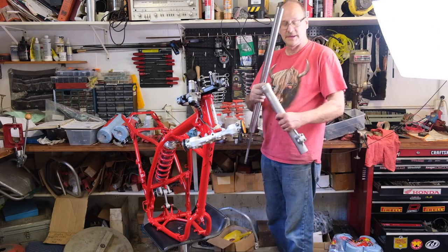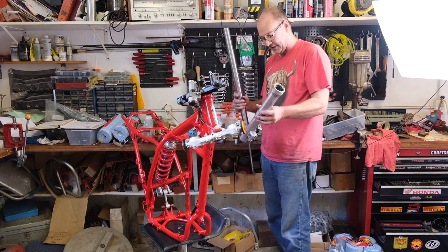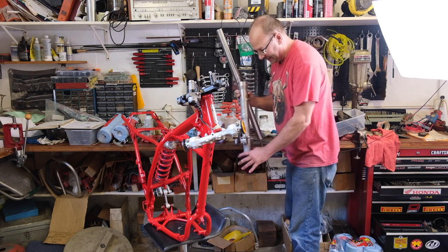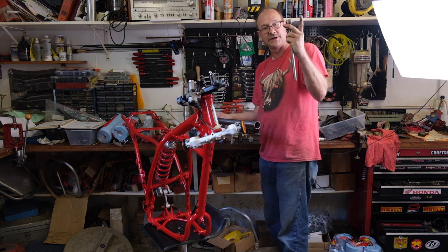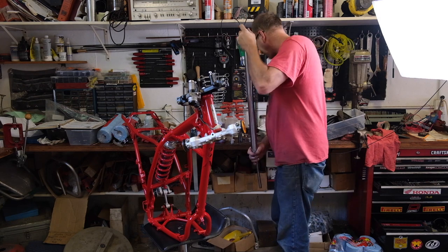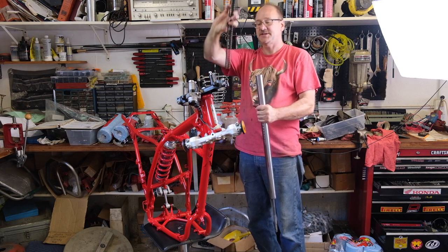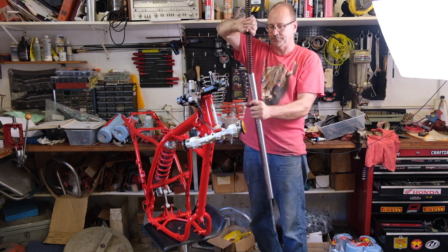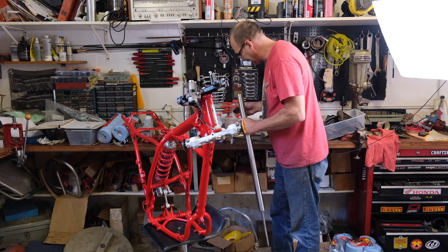Get the forks out, put new seals. I can put the dust cover on after I put the forks together. I'll show you how to put the forks on. There's a lot of silt - aluminum silt down the bottom - you need to flush all that out with brake cleaner, then put your rod with your little piston ring, and there's a spring that goes underneath that. Drop it down gently. The previous person must have worked on this before - they put the spring in upside down. It's the tapered side - if you look close it kind of tapers in, that goes down. Both springs were upside down when I got them. Then there's a little flat washer.